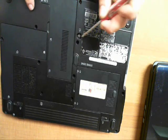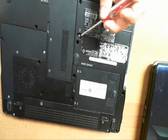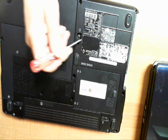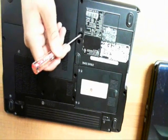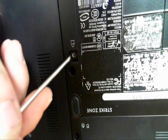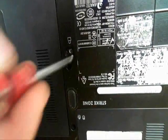Right down in there, if you can see, right above the little lock button, there's going to be a screw. It's only a single screw, and let me move this closer for you. You're going to be able to tell that it is connected to the CD drive — it's going to have kind of like a horseshoe bracket that the CD drive slips into and then screws and mounts up.